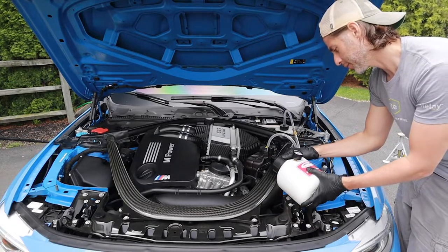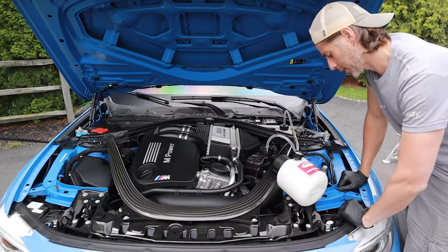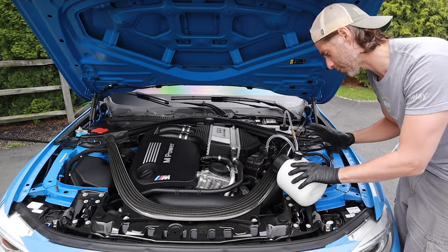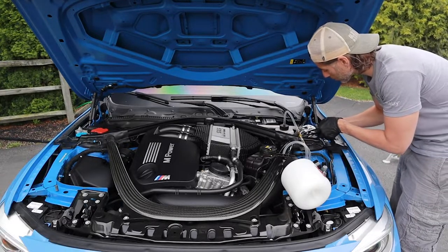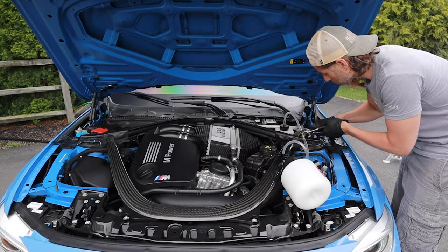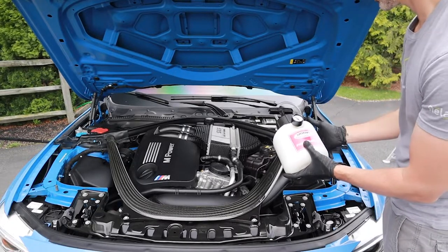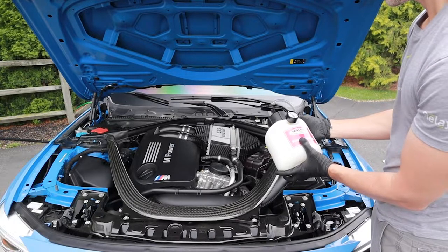So I pumped this up to about 12 PSI. I'm just sitting here making sure this needle doesn't move. Hopefully the connection is good and there's no leak. Just a heads up that you pump it a whole bunch of times and it kind of feels like it's not really going anywhere, but it just takes a lot to get it past 10. I'm trying this again after tightening up the connection a little bit more with some pliers — I think that looks good, no movement at all.